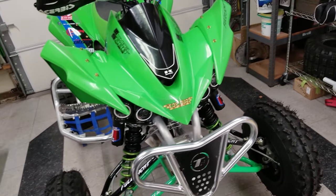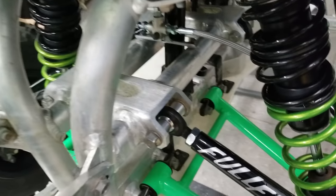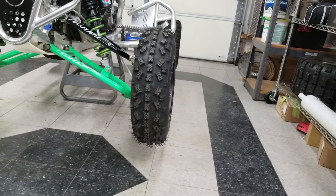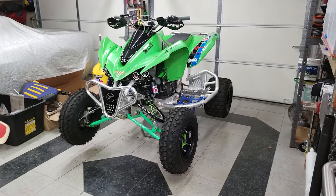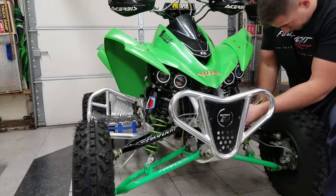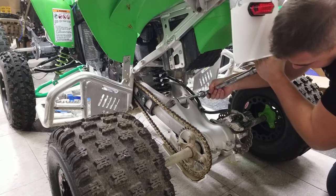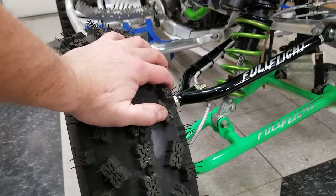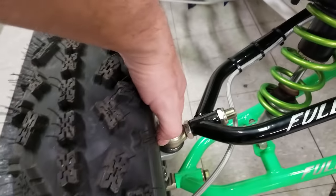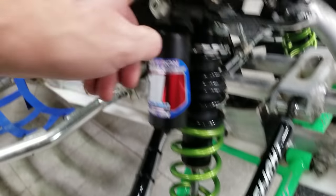Looking pretty good - it's almost perfectly straight with just a slight amount of negative camber, which I like to run just a little bit. We can take it off the stand, take all the slack out of the suspension, tighten up all our bolts, and see exactly where we sit. We are all torqued down nice and tight. I didn't do any fine tuning with the outside adjustment - just did the four and a half turn-outs. I torqued the A-arm bolts and shock bolts down to 27 foot pounds, the hub nuts to 53 foot pounds with a cotter pin. The rear main linkage bolts - top and bottom - are also 53 foot pounds.